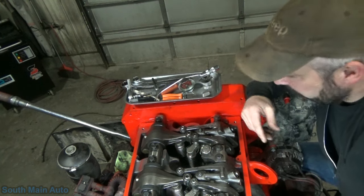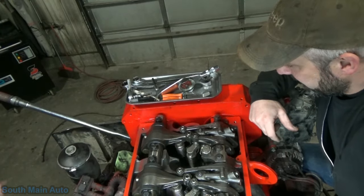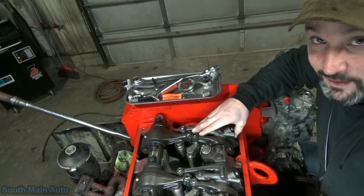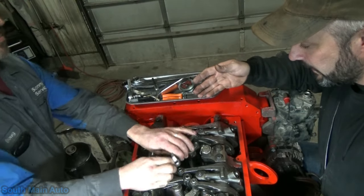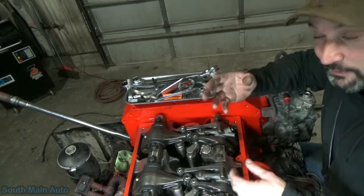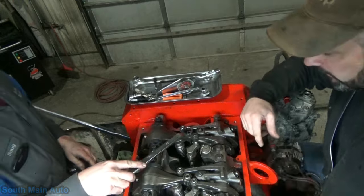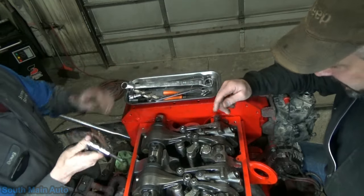In our video where we took a wrecker call, we were slamming on the exhaust brake a lot because a lot of guys like it — it sounds cool, jack hammers blaring. Instead of going through the concept of engine brakes here, I'll throw a link in the description to a Jacobs YouTube video on how an exhaust brake works — they show the cycling of the valves and how the exhaust valve stays open and overlaps through the power stroke to retard the engine.